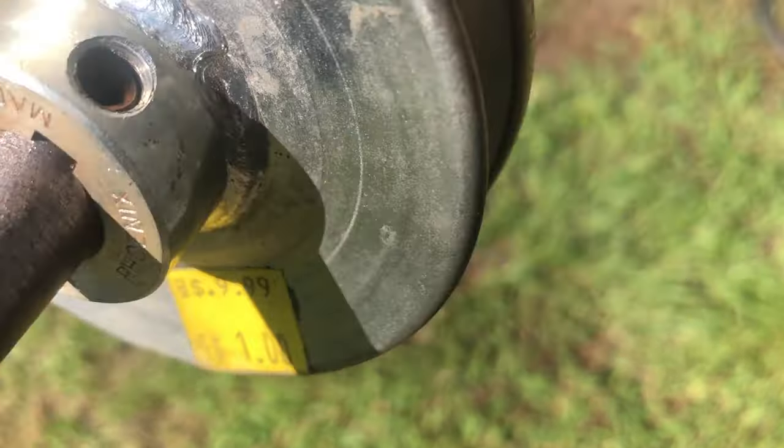Before I do that, I'm going to try to tap into this ground wire, have it work here and from the key switch. So here on the mower, I just wired up this switch. If it's in the off position, that is the run position for this mower. If we go like this, it sends the ground from the coil to the frame, shuts it off. I also have the kill switch here still installed. So we'll put that in the on position. We'll put this one in the on position. My throttle's now hooked up. Choke off.